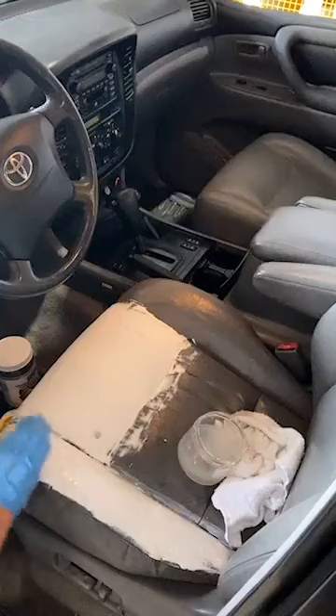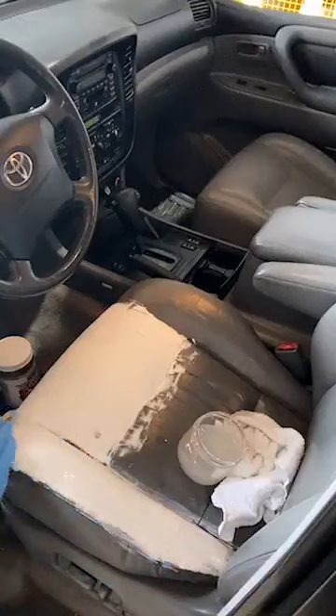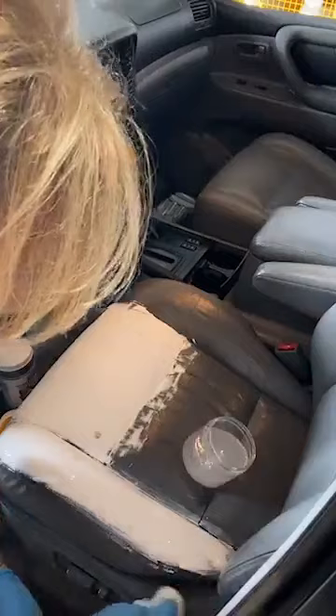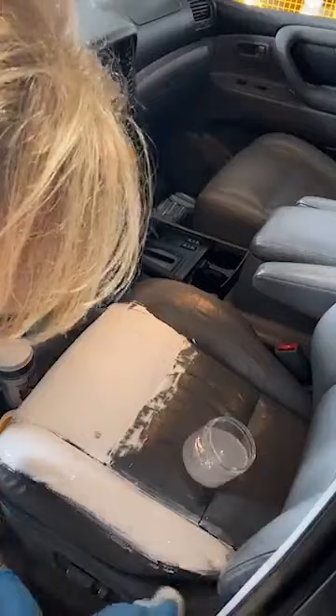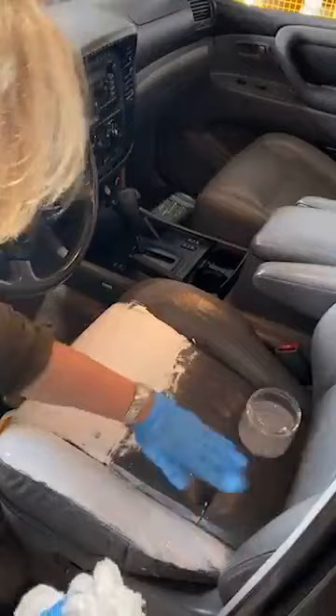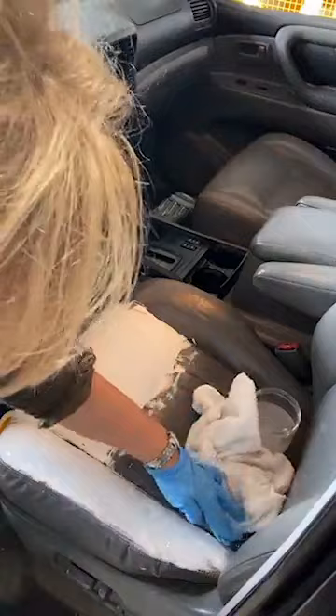You can see it almost gets like glass with just a little bit of water — move it around and you can feel it getting smooth, silky smooth. That's what you want. You don't want to leave it heavy in texture because you can't sand that much away. Make sure to rub off anything excess or running down the rest of your seat. Don't thin it so much that it becomes fragile along the edges — you don't want to go back into non-affected areas with a very thin layer.